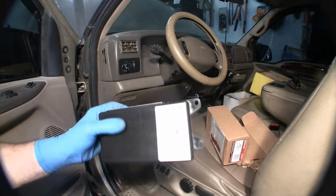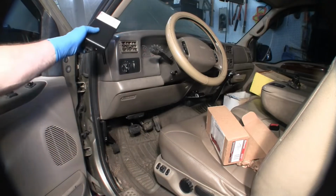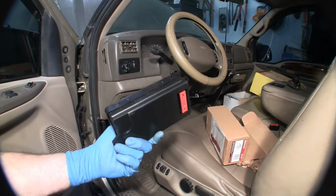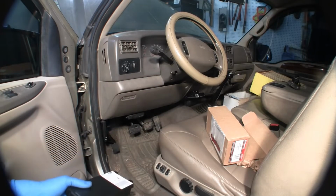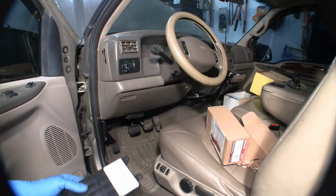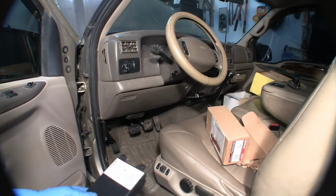In doing a little bit of research on these guys, one thing you might want to check first, I don't have any leak. Check for a leak at your windshield. Get down there, take it apart, look for water in the connections. I don't have any water or anything I can see back there. But sometimes there's a water problem, you replace this, you still got a leak, then you just blew several $100s.